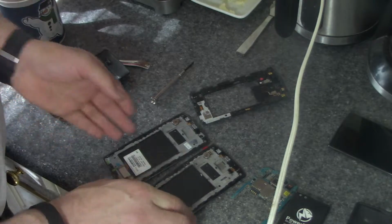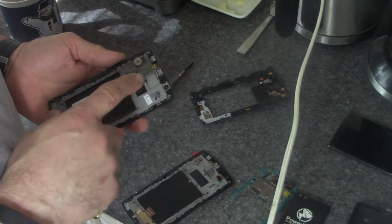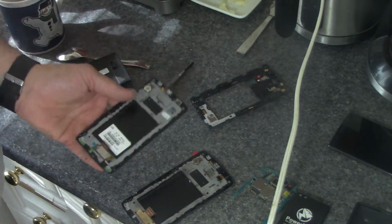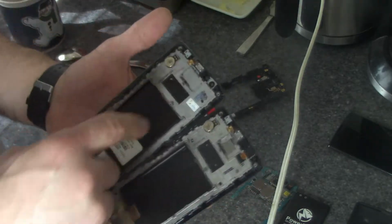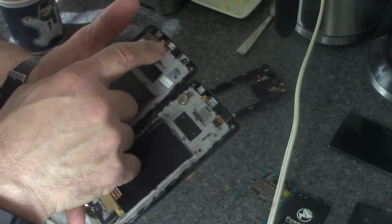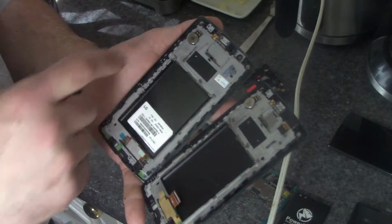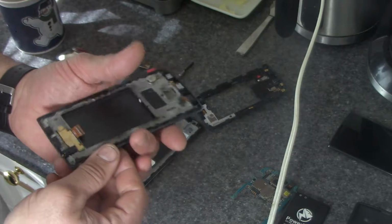Before I go any further, there are some things I need from here. Wow, this is pretty. When I got this screen, excluded were a lot of components. That too. Well, that's the headphone jack. So when I got this screen, I had to install the headphone jack, the front camera, the microphone, this thing which I thought was the proximity sensor, and this thing which is the vibrate. I don't know if you guys can see that. This has all that attached. Like, this is factory fresh.